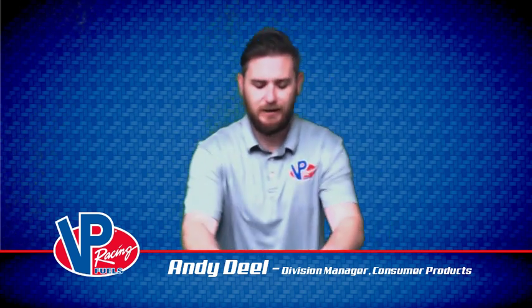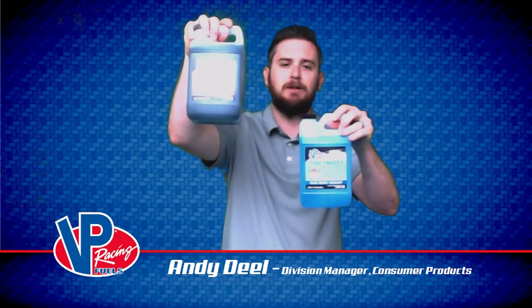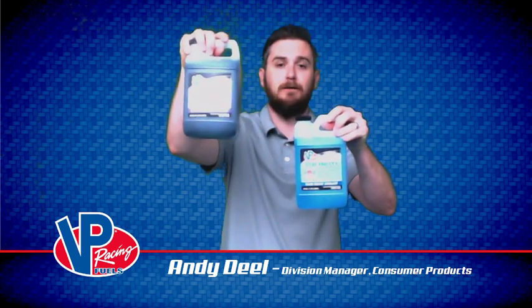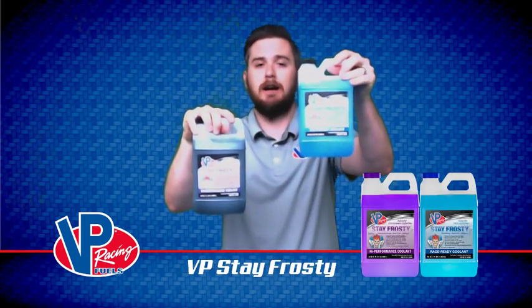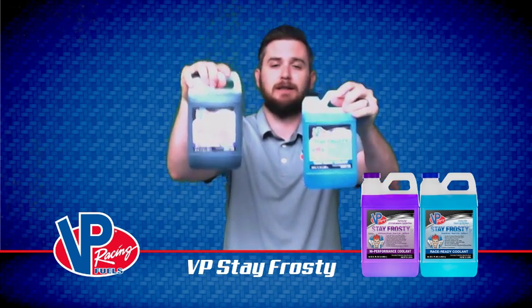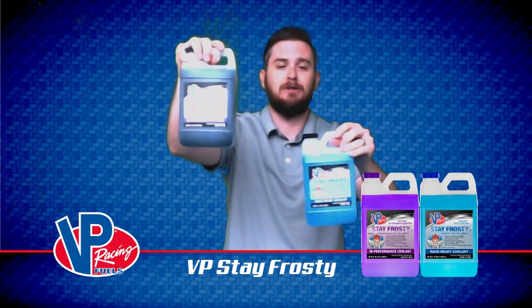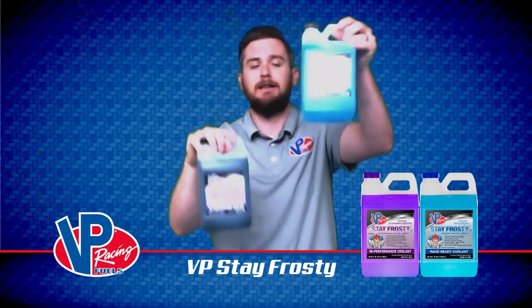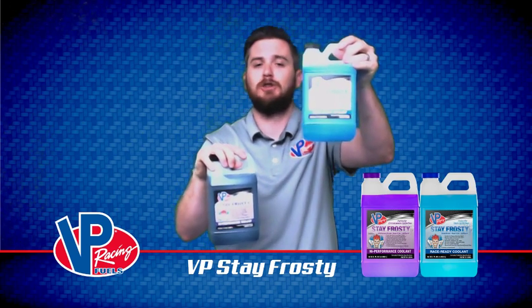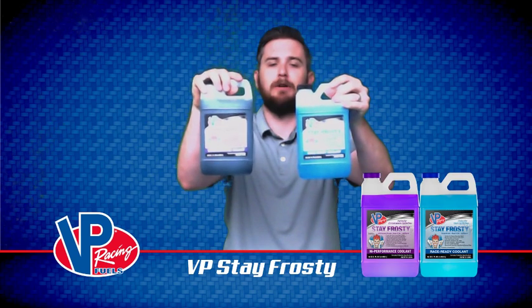On the differences between these two products and the colors, this one has freeze protection, so it's got some percentage of glycol in it. This one has no glycol, no freeze protection. Both of these are ready to go as coolants. This one's got some antifreeze properties, so it's safe down to 0 degrees Fahrenheit. This one has no freeze protection, but it's track and sanctioning body legal. So that's really the material differences.